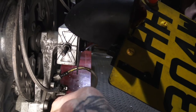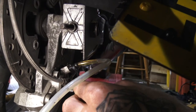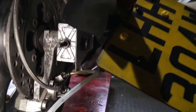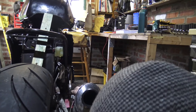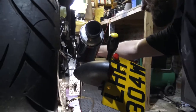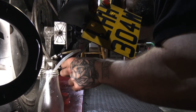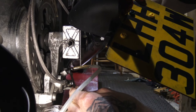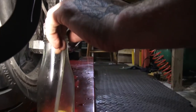What we're going to do now is I'm going to hold the pedal down. I'm going to pinch the nipple up, and then we're going to give it a bit of a pump. We're also going to check the master cylinder. I'm going to hold the brake down and crack it off again. Sometimes on this it can take a while — motorbikes can be a bit of a challenge to bleed. What you don't want to do is get stressed and quit. We make sure it's submerged before I let go of the brake pedal.